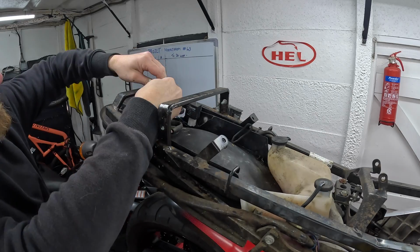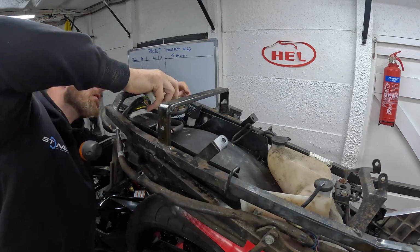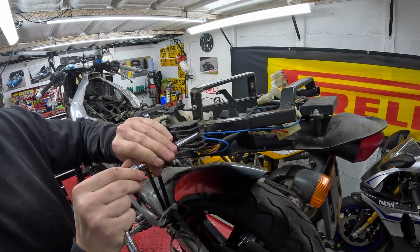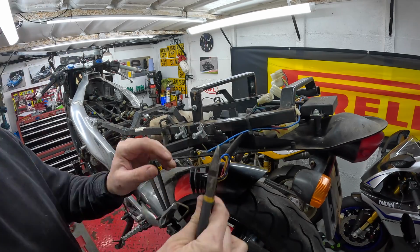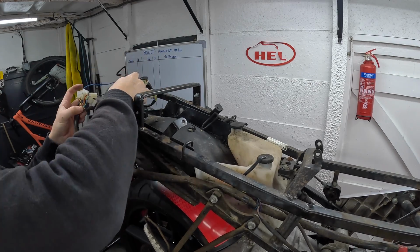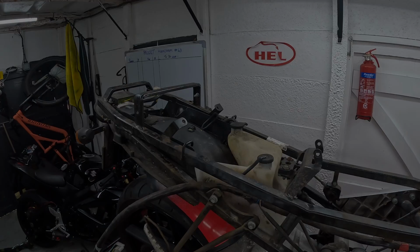With my super idea of the airbox left to one side, it was time to take the rear of the bike apart. The subframe was looking pretty rotten, in all honesty, and in order to get it painted we were going to need to remove all the under tray, the regulator, the tail light loom, and as you can see here, more GT85 to try and get that rusted bolt undone. And it really was testing for something that should take a couple of minutes, but as always, part of the fun.